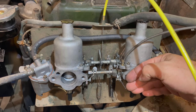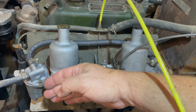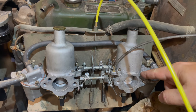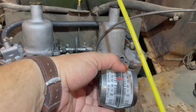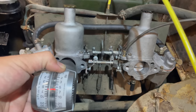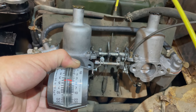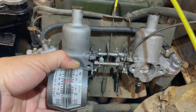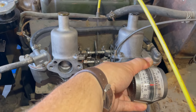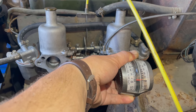Alright, it started. If I put my hand over this carb the engine wants to die, but if I put it over this one it doesn't affect the engine much at all — so we know the engine is mostly running on this carb. Using the Unisyn tool, this one reads about 11, and that one reads about four, which verifies we're running mostly on the rear carburetor. Front carb is just above seven, rear is about nine — I need to turn that one down still.